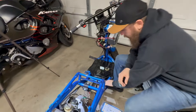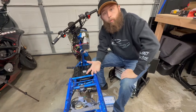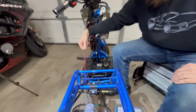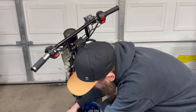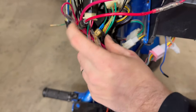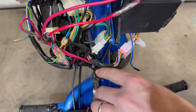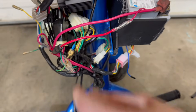Went ahead and cut off a little bit of that line — now it sits a lot more flush. All we have left to do is the wiring: connect a power and a ground. Like I showed you, I have already extended my power. I'm going to run this underneath my gas tank. I already went ahead and put a double bullet connector on a red and a black — one for constant power for my air ride, and one for constant power once the key is on. The black is for when the key is on.